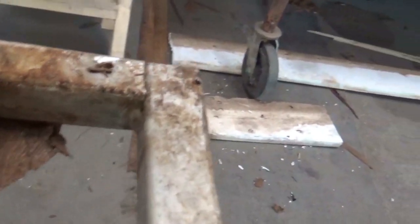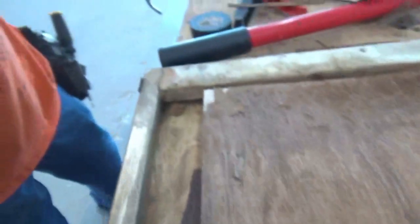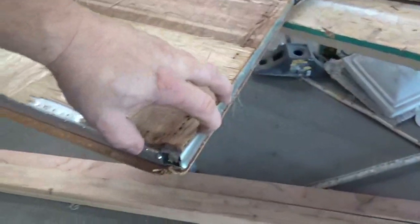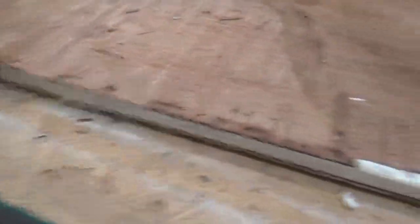Same with this — you can see there's no welds around this corner here, there's no weld on that side. All they do is hit it right there. So all I got is that one weld in the corner — there's no other welds on it. They usually just tack them once, that's it. At least with wood, you'd have a little bit more strength. A lot of this — I guess you'd call it shoddy workmanship — is because these things are put together to work as one component. They're light, but they need to work as one component. And if something fails, it's almost like a domino effect.